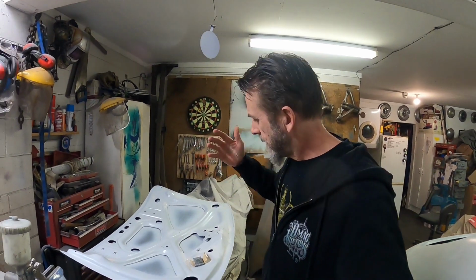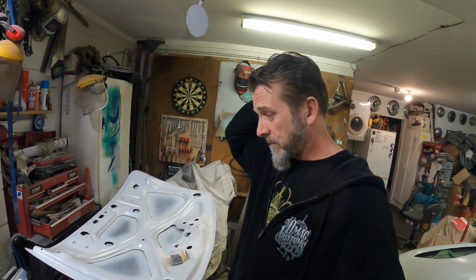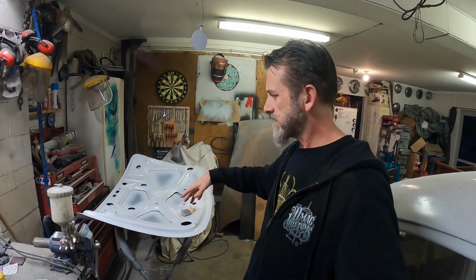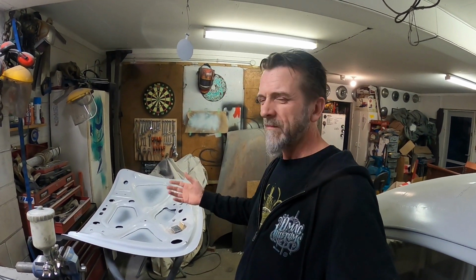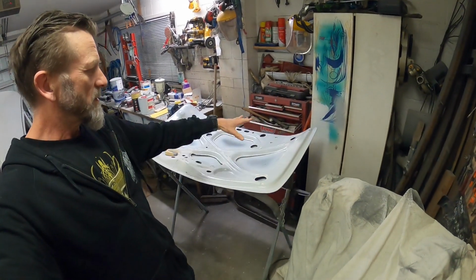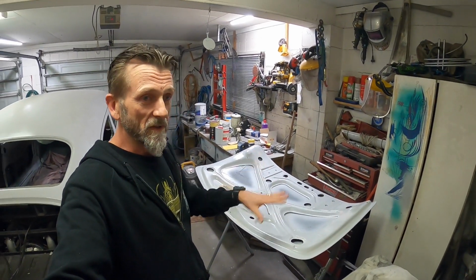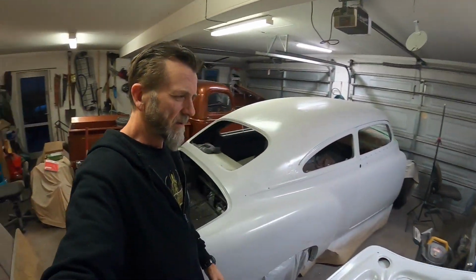Been doing some thinking. This morning I came down and did a little bit of the glaze spot filler on under here, and I've just started sanding it back. But I was thinking about my predicament, I want to get this into primer and do as much as I can without leaving it sitting for ages. So I came up with this genius idea on the way home, as I was driving my car. I could prime all this and actually paint it, at least get it sealed up with some of the colour, and then maybe just scotchy it so it just needs a final blow over later on, you know what I mean?